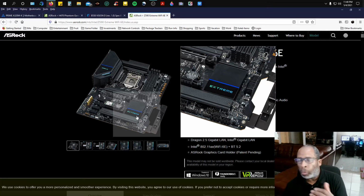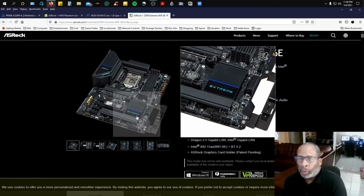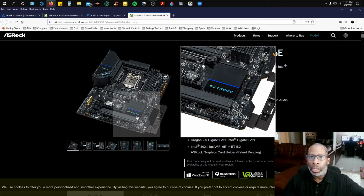The more overheating it does, the harder it works, and the harder it works, the more it blows itself out. So the main thing is to make sure you get a case with an open air design. You want the push and the pull: pull air in, and push the hot air out. If the cooler is pushing in, it's cooling off your components and releasing all that heat out of it.